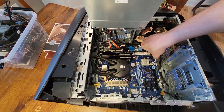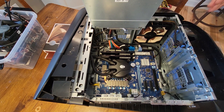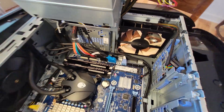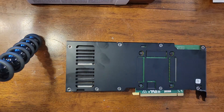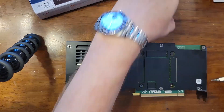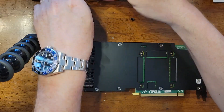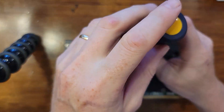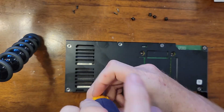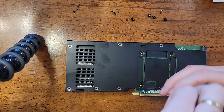Final glimpse of the case with the new fan installed. Remember, you want to have that fan pointing air in — you're trying to bring air into the case from the front. This is the 3080 — see the screw layout. The key when undoing the screws: go opposite corner — one corner, opposite corner, in a crisscross pattern. That's for those black screws with the spring specifically, because those are the ones holding down the tension load to get the actual graphic chip properly seated against the metal plate.